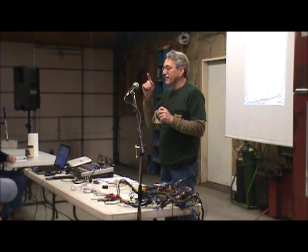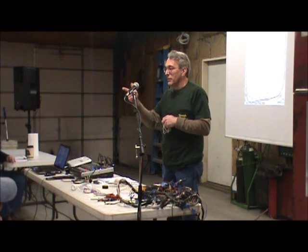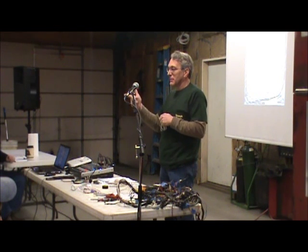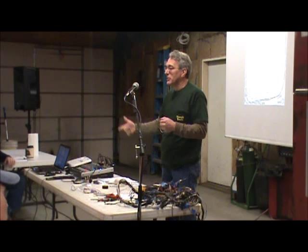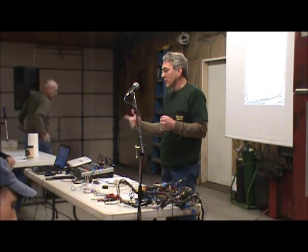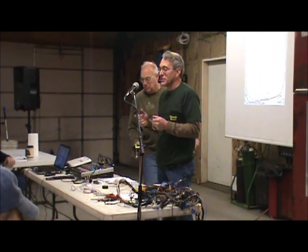When you take the old harness out, don't chop it up. Remove it whole. Lay it out on the floor. It'd be a big help. Use it as a road map, just to get an idea. Okay, I remember this came off of there. Tag a few things if you have to, because that's always a big help.